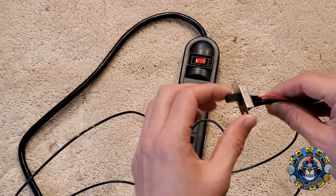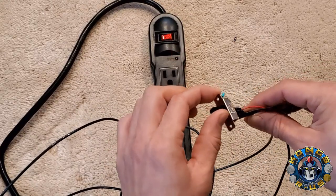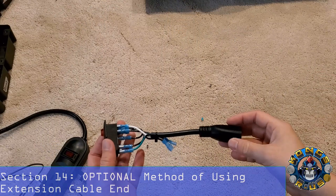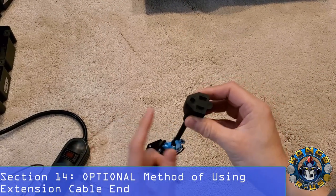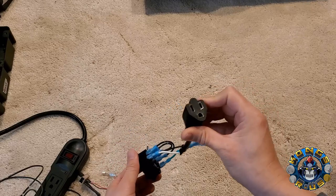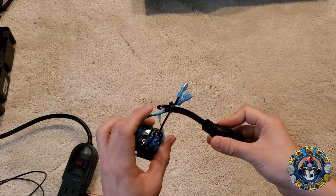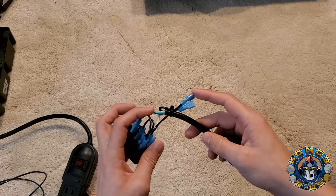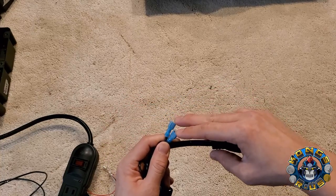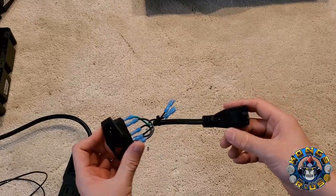Once you have everything wired up, you can plug your Pi or PC in, and this is going to start up everything when it detects power. Please make sure you follow everything carefully — this is electricity after all, so use caution. One optional advanced step: if you have extension cables, you can create an extension cable so you don't have to cut the plug on your surge protector, keeping it reusable. Just grab the black hot wire from the extension cord, make a small jumper wire using your 14-gauge wire from the hot wire to the switch, and wire up the two cables directly into the Arcade 1-Up switch the same way. Hope that's helpful — thanks for watching!